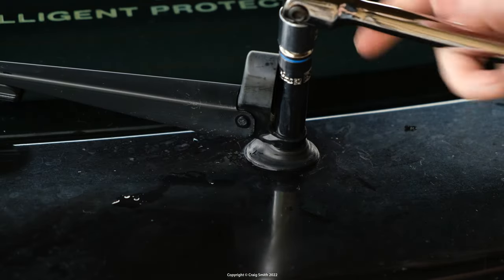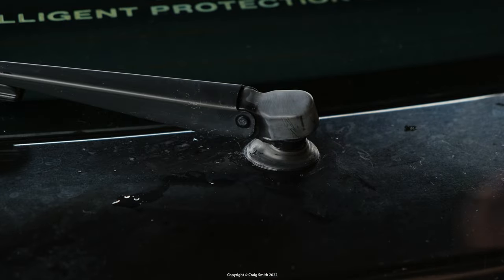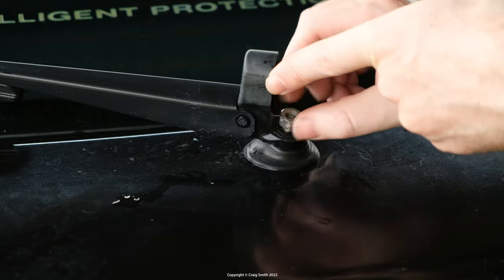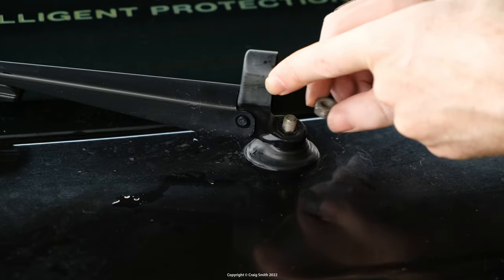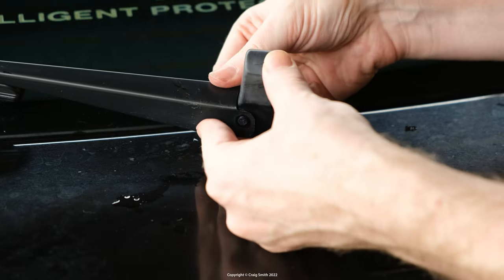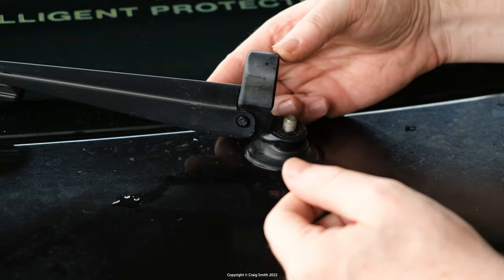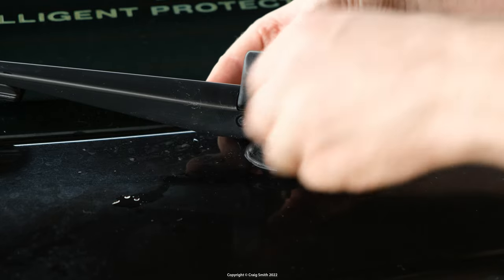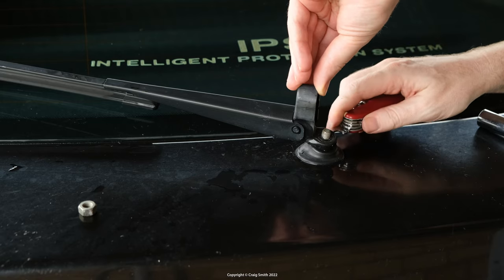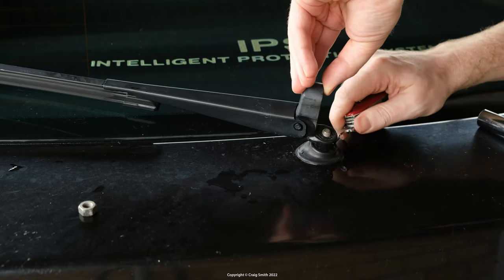This is how you remove the wiper arm itself, obviously, if you need to replace that or get at the motor underneath for some reason. The shroud cover there just pops up, and the wiper arm is retained with a 13mm nut. Comes off very easily. The bracket for the arm is splined onto a tapered fitting below the nut thread, and its spring tends to hold it on there, so I needed a tool just to pry it up a bit before it would lift off.